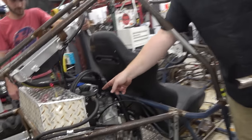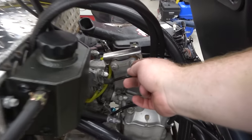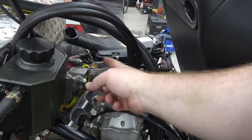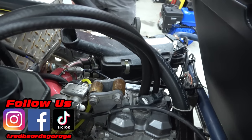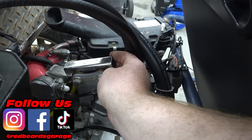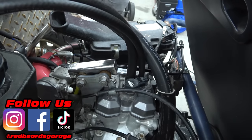So why that's important is, if you'll come over here, I need to support the upper engine mount so all the power won't make it twist. So what I did was I machined two blocks to put in between this original mount. And then I notched this morning. It sets down on there. I weld that to those blocks, tack it a bunch of times.